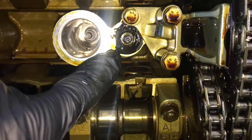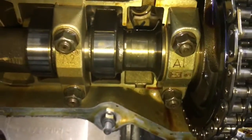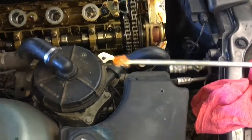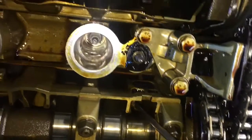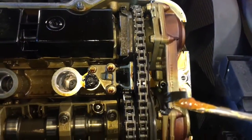As I was picking out the pieces of the old gasket, one flipped underneath the cam. A tip for getting those out: take a screwdriver and put a blob of grease on the end of it, then go down there and stick it on the plastic piece. It will stick to the grease and you can retrieve those little plastic chunks like that.